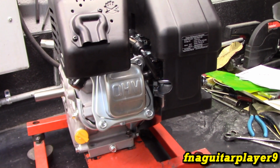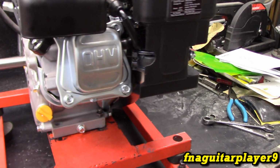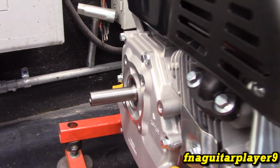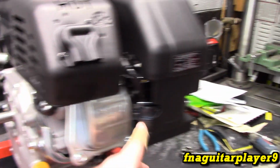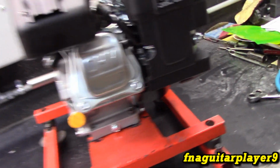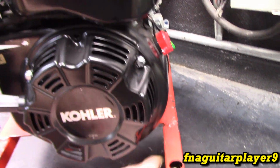Good running engine. Notice at full throttle it's surging just a little bit. It's probably running just a little bit lean, and it's a non-adjustable carburetor, but that adjustment there might help with that a little bit, but it'll also smooth out once it gets under load, because just some engines are like this, and they're making everything run so lean nowadays. And like this was your older type carburetor, it had the adjustment on the bottom, just a slight little bit of a turn would smooth that right out, but it is what it is. But good running engine, I'm impressed.